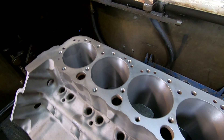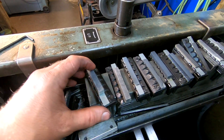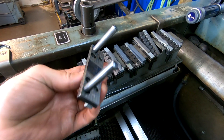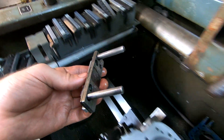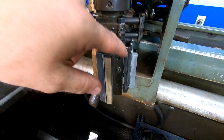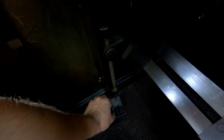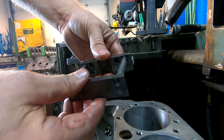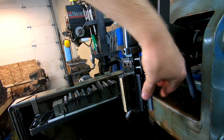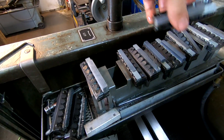At this point the block has been rough bored and there's roughly six thousandths to come out of the cylinders. We're going to go straight to the roughing stone. It mounts to the mandrel pretty much the same way and also uses shims, except we don't use that tool to set it up — this one we pretty much just set up by eye. With just this little thin shim, you can see that doesn't line up, so grab a shim and slide it over there. Once you've got a shim that fits nice, you set that up.